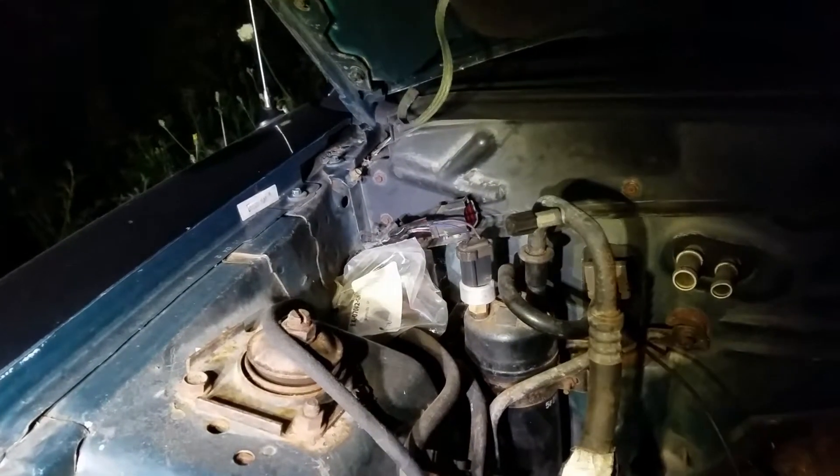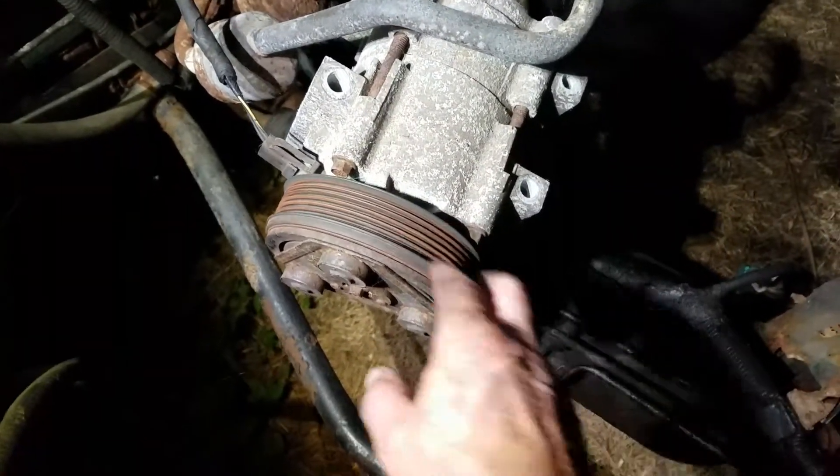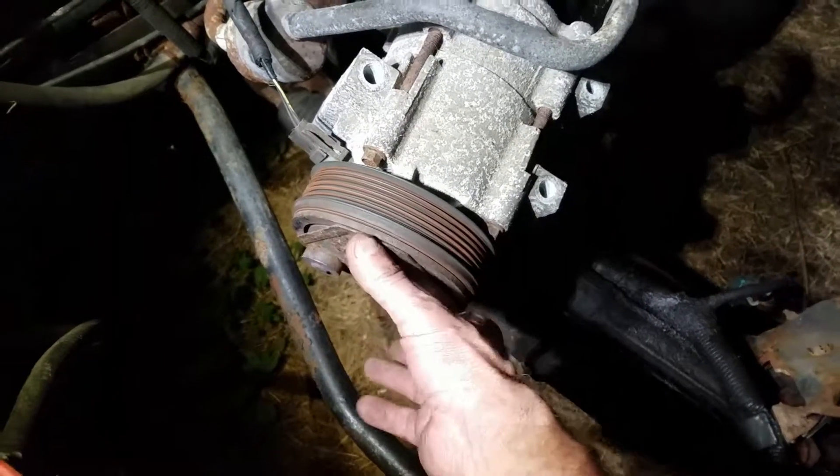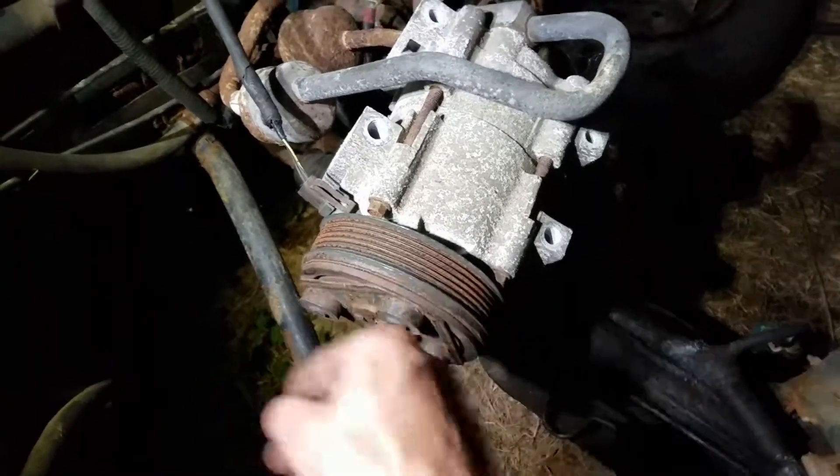Here's the original one. This is the '95. Unfortunately the history behind this one is the frame is rotted out. It's got a dryer on it, but unfortunately the dryer is shot because it's been compromised when this was taken apart. Here's the other compressor — I'll probably yank this one off and stick it on hers until we get a new one. There's your pulley and it sounds really good. When I pull the other one you'll understand what happened — things in there seized. This is actually a good compressor, so there's no reason we can't probably use it again.